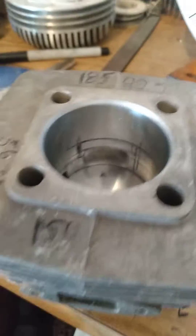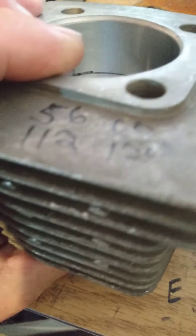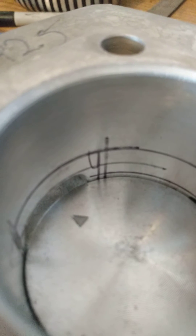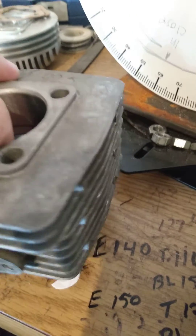A question about why, on our motors, the exhaust port floor extends beyond where the transfer opens. Number one: blowdown is an important part — that's simply the separation between the exhaust port opening and the transfer opening. That little space in between is blowdown. Hence why increasing exhaust duration also increases blowdown, giving more time for the spent gases to escape.